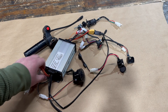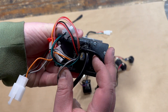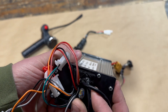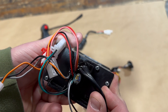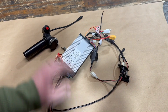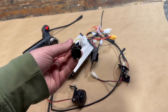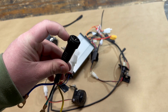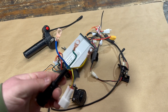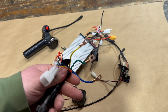In order to get an aftermarket controller in, I needed to make some wiring. You can see there's a blue, a yellow, a green, and then five little wires — the phase wires and the hall wires. I cut this off of the stock controller and made a wiring harness. I kept the factory Burromax connector on one end to connect with the factory Burromax motor, and on the other end I put terminals and a plug so it would work on the Far Driver controller.